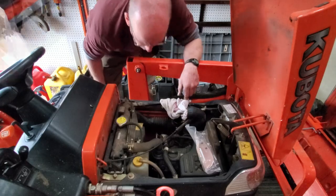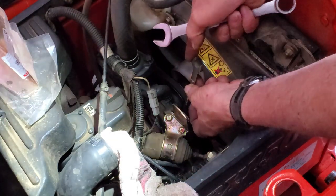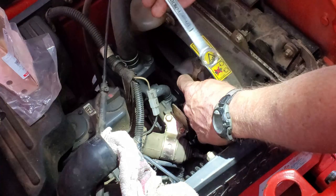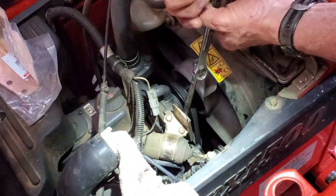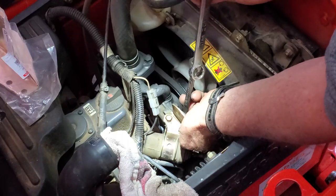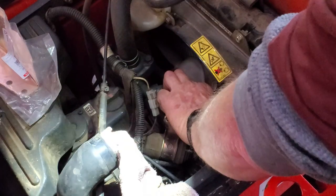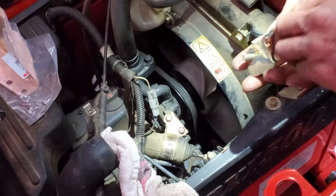What happens is this clamp breaks here, and when it does this whole thing shakes and rattles and rolls. But since I reinforced this with the band clamp, this broke. Let's get this apart on the bench over here — my makeshift bench — and we'll bring it back over and get it mounted back up. We've got to get the other half of this all mounted to the top of the motor. The bolts I need to get at are down here. What you can do to get a little bit of leverage: this little wrench doesn't have a whole lot if I really start cranking inside the engine bay. Lots of sharp little ledges to smash your knuckles on. So take this bigger wrench — in this case it's a 17 millimeter — interlock it with the open end of this wrench and hopefully break that loose. There's a little backing plate on this as well — not sure what its function is, but it goes back in of course.